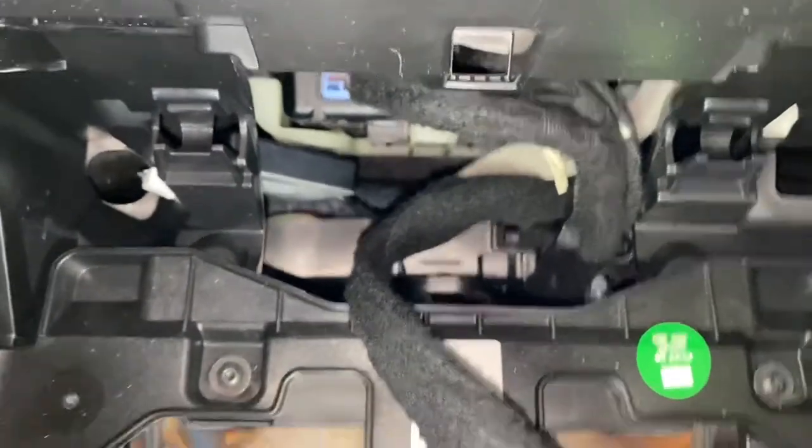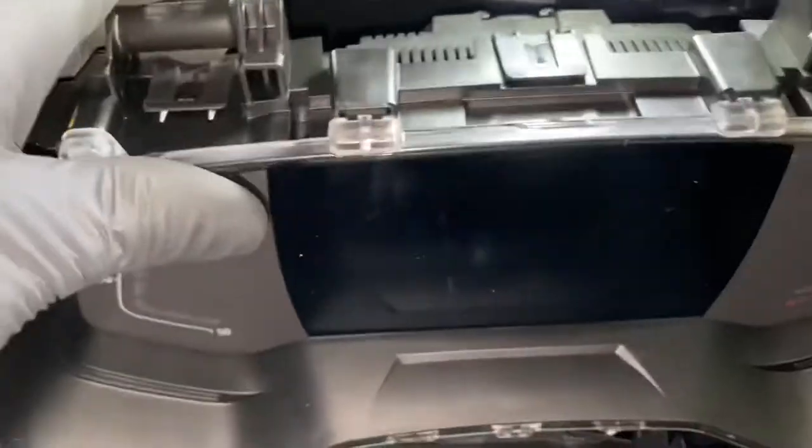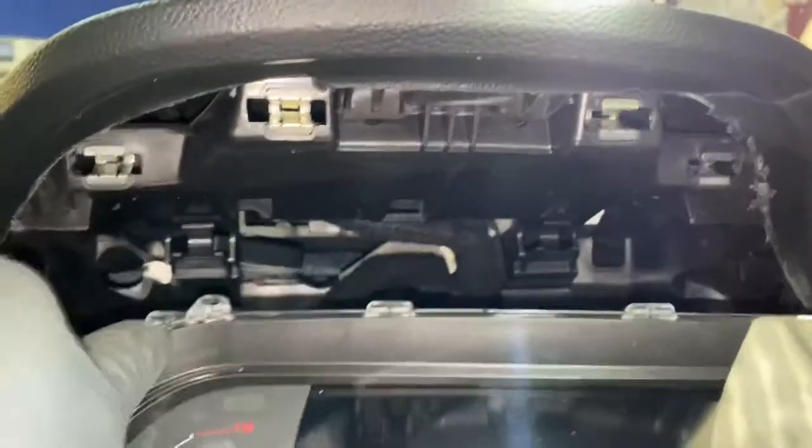Now I'm going to put the instrument cluster back in. So I've got the instrument cluster, plug it in. Now the trick to this one is, I said we need to slot it back into those grooves. There's one there, as you can see. So that's the first bit to do. So make sure we just slot it in there, like so, as you can see. Push down like that, as you can see,